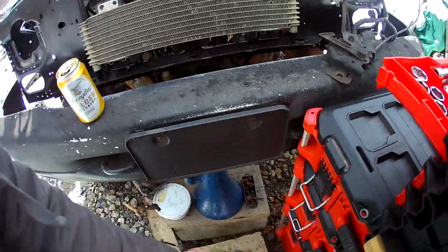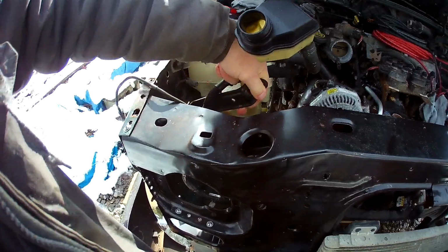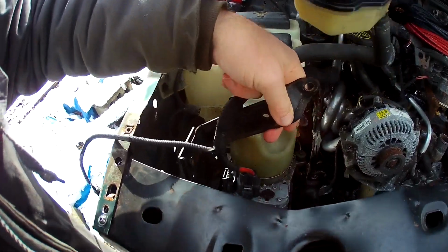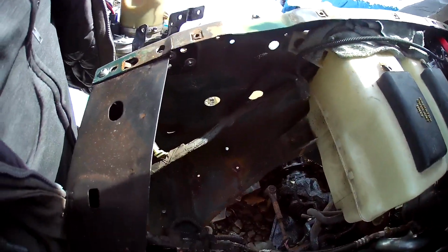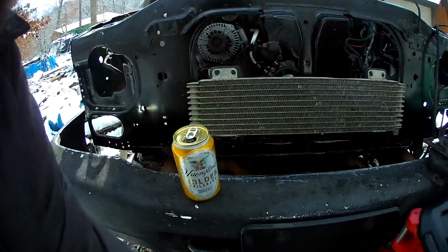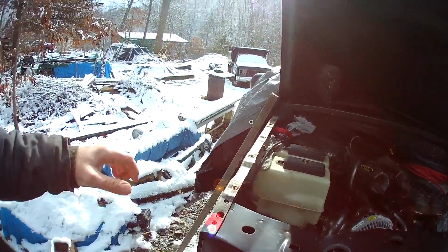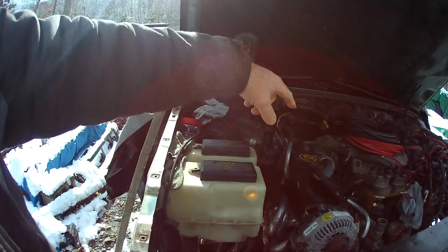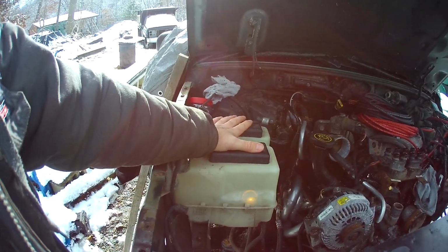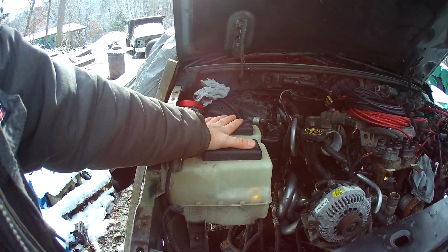I was looking at putting this guy in, an electric power steering pump, which would go roughly here-ish. I'd have to do something a little different with the reservoir. I'd have to cut some of that out down there, make it fit. Not a whole lot because it'd get in the way of the tire and the fender well, but I think it'd fit reasonably well. The only problem is I'd have to do something different for the intake and these guys to make enough room, and that's just more than I want to get into right now with needing this truck on the road yesterday, basically.